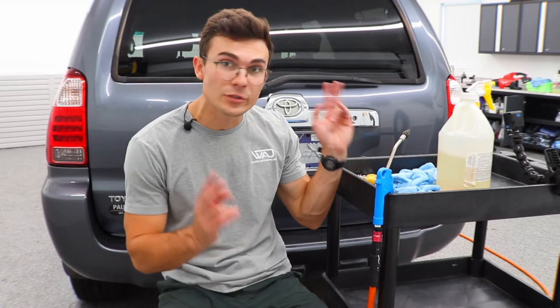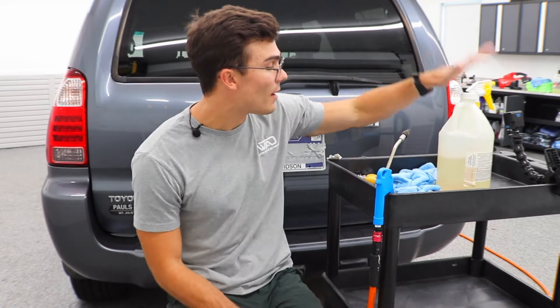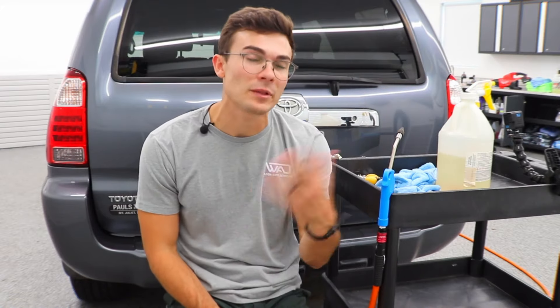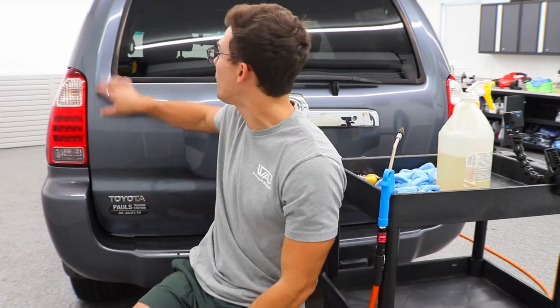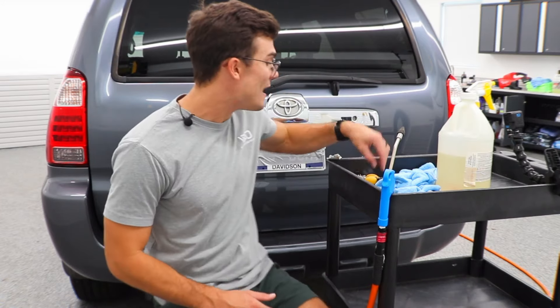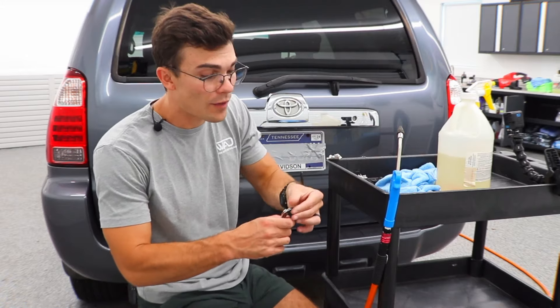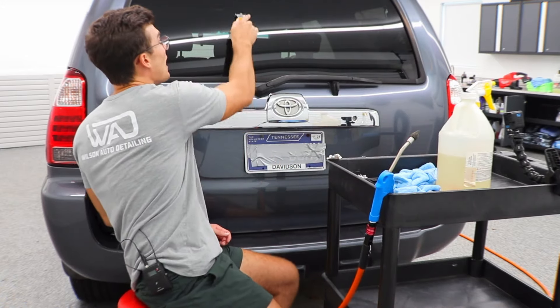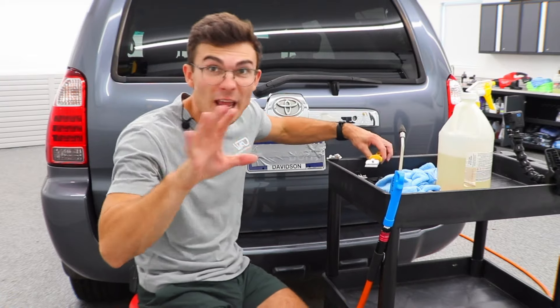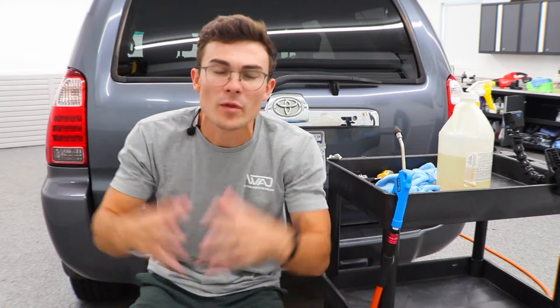I use an air compressor, two microfiber towels, Optimum No Rinse, Rapid Remover, and a metal razor blade to remove things like this. The plastic razor blade is generally what I reserve for something actually on the paint, because metal will scratch into the clear coat. On glass, a razor blade is one of the best ways to do it — it's also a great way to clean glass. If I've got surface-level water spots or things I can't get off with chemical, I'll scrape the glass up and down until I basically shave all the gritty pieces off entirely.